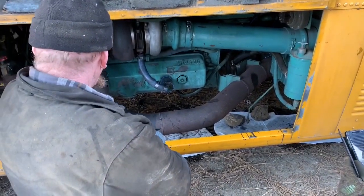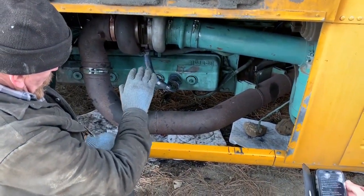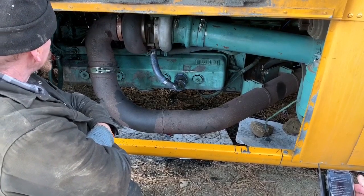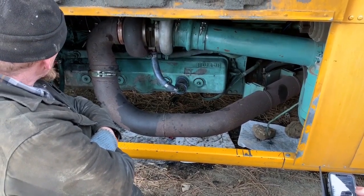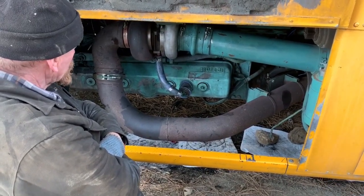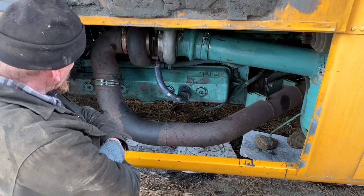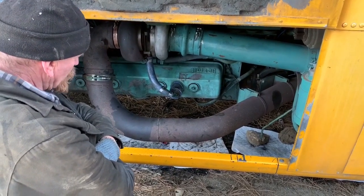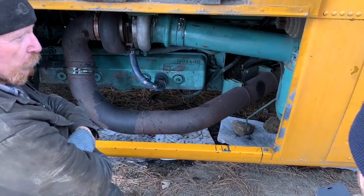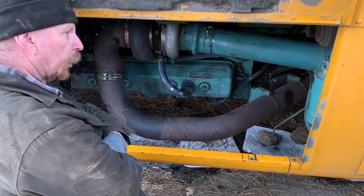When I was doing the fuel filters, I was looking underneath, and the engine tips this way just a little bit. And the unfortunate thing about this, with it laying on its side, where the airbox drains are, they're in the middle of the block. Usually if these engines are standing up, the airbox drains are lower. And then they put a check valve on it so that it doesn't slobber when it's sitting and idling. The check valve opens when the airbox pressure comes up, and then allows any excess oil to blow out.